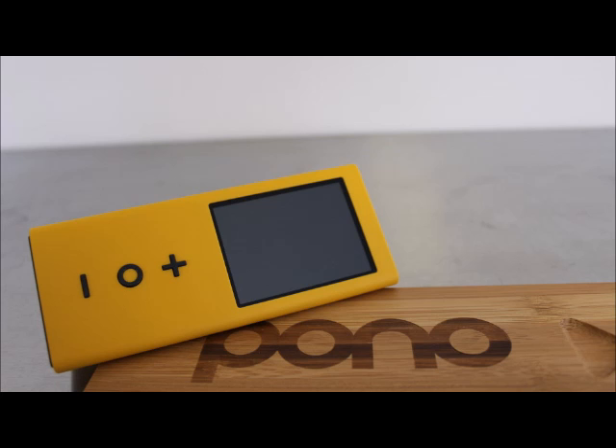The Pono Player's primary face contains a 2.5-inch touchscreen and three hard buttons — two for volume, along with a multi-function play/pause/skip/power button. Their plus-circle-minus arrangement, with the shapes cut to be the whole of each button, is more attractive than a standard square or circle button design, but it gives the unit even more of a toy aesthetic than its yellow paint job already does. The body is covered in a smooth, rubberized plastic, meaning fingers can easily rub across its sides while still finding traction if the unit rests in your hand. The player is just a tad smaller than a grown-up hand. The Pono Player comes in an isosceles triangle shape. Pono's creators insisted that the triangular shape was necessary to fit all of the player's parts, but after reviewing a recent teardown, we wonder if the capacitors — the major culprit for Pono's circuit board bulge — could have been repositioned for a flatter design without increasing the size all that much.